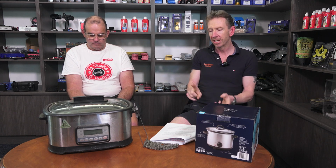If it's really harsh conditions, like if you know in advance it's going to be really harsh conditions, and your original treatment may run out quite early and you're going to have to do multiple top-offs, that's when it might be worth considering a really long-lasting wet lube. So something like Silca Synergetic or Nix Friction, or there are some others that I'm testing at the moment which are proving to be extremely good, which is Revo Lubes and Rex Black Diamond. There will be others as well. I just haven't had a chance yet to test all the top wet lubes that may be out there. But yeah, plan for what you may do.